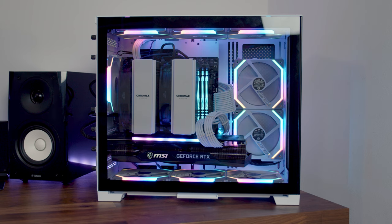The next thing I wanted to test was how good this case is for air cooling. One advantage this case has over the original O11 Dynamic is that even though it's smaller, you can actually fit bigger CPU coolers — up to 172mm height. Noctua's NH-D15 at 165mm should fit. The heatsink itself fitted without any problem and I was even able to add the white covers, but I wasn't able to mount a fan on the front of the heatsink — it was just catching on the RAM. I was using the HyperX Fury RGB, which is fairly low profile, but with this I was not able to get the glass front panel on. The middle fan fitted without a problem and instead I mounted the second fan on the rear of the cooler, where I was just about able to close the glass panel, though the fan was resting on the glass and there was some vibration noise.